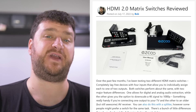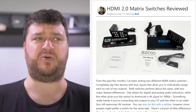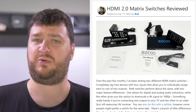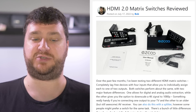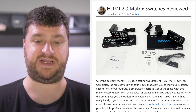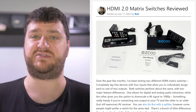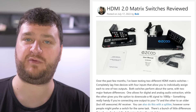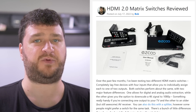I finally found two HDMI switches I don't hate. Anybody following me knows most of these drive me crazy with retro gaming — very often they don't work, or they freeze up and you have to power cycle, or audio just stops working. A lot of HDMI equipment freaks out with retro signals. These two didn't. Starting with the cons: these do not support 4K 120, they probably don't support variable refresh rate, and they will tell your streaming box or console that your TV is Dolby Vision compatible even if it isn't — so just watch for that. There's also no CEC control, so using your Apple TV remote to turn off all your equipment won't work through these.